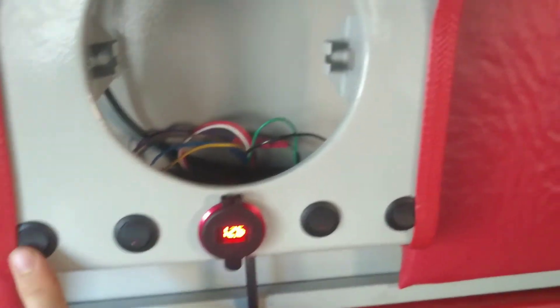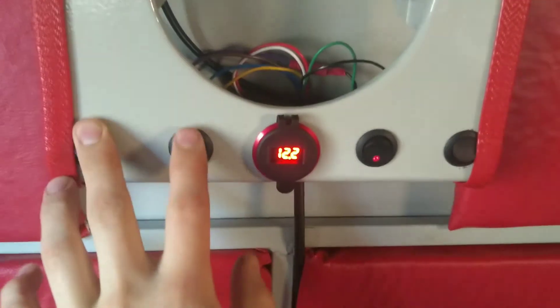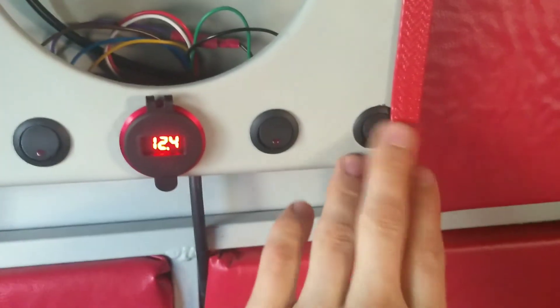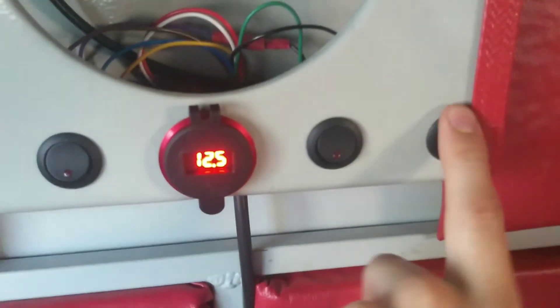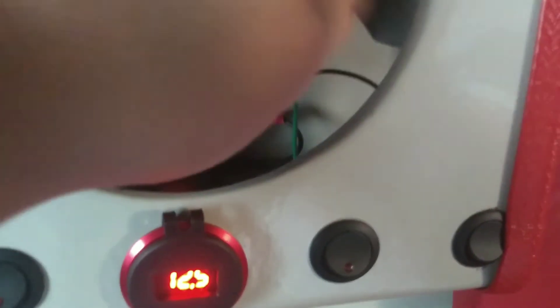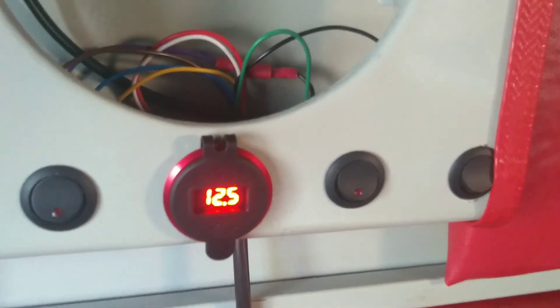This one is a fake switch — not even connected at the back. This panel on the centre of a Morris Minor has five holes on it anyway, and I only needed four, so let's just turn all them off — that's more for the looks than anything else. There is an extra way on the seven-way cable, so I could in theory one day add something to that. And there's two spare ways on the fuse box as well.